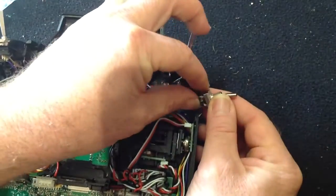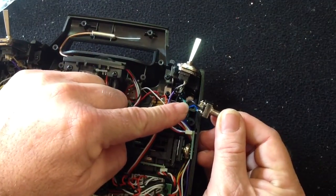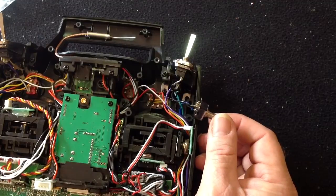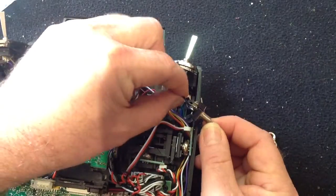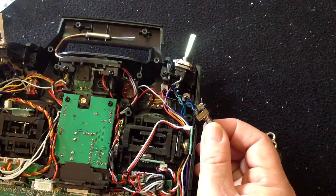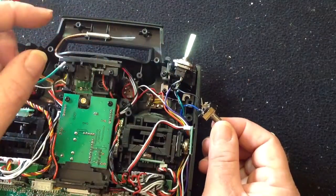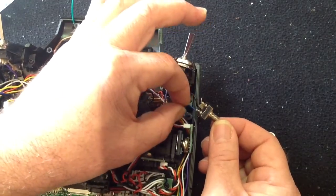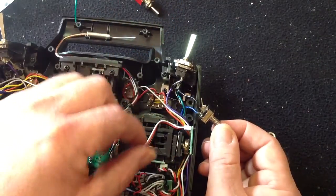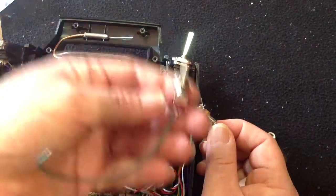Here are our connections to the existing elevator switch. We have a black wire, which is your ground wire, a blue wire, and this contact here is free. You need to disconnect both of these wires because this switch is coming out. The black wire will connect up to your replacement elevator three-position switch. This blue wire becomes actually vacant - you won't do anything with this blue wire when you replace this switch; it will actually go on to the next switch. So this blue wire will be free. I'm going to go away and disconnect these two wires and connect up the replacement switch.